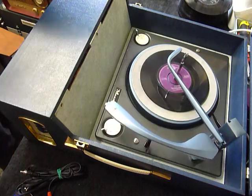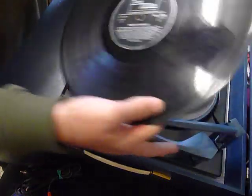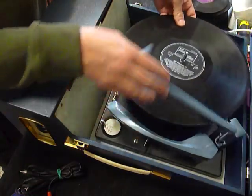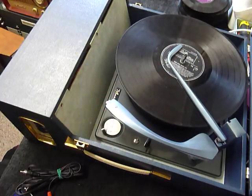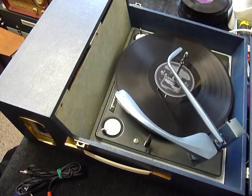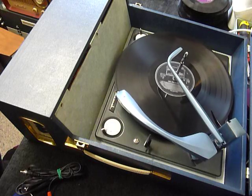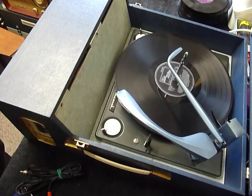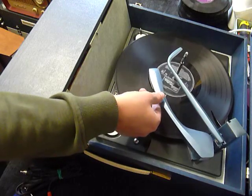I'll just demonstrate with the start of a 12-inch record as well. When you stack a 10 or 12-inch record, this is the size selector lever — you need to make sure the record is stacked above the lever like so. That's so that the tonearm knows to land in the correct position, and of course the arm lifts off automatically at the end of the record.